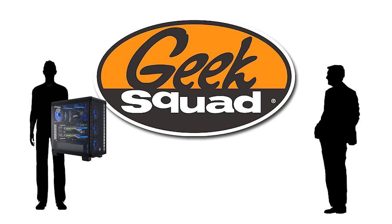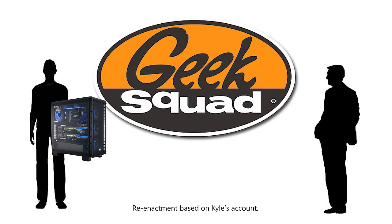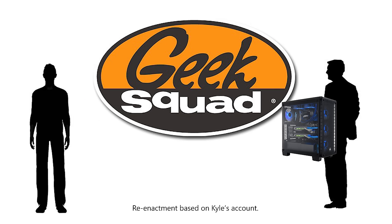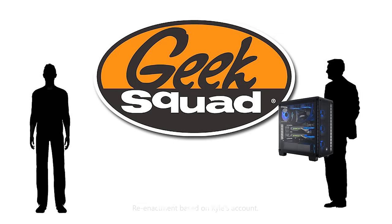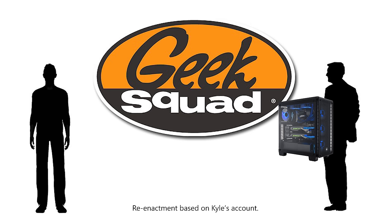So I just picked it up on Craigslist — I plugged it in, there's sound, the light comes on, but no picture. I don't know what's wrong. Did you plug your monitor into your card? Yeah, I even watched YouTube videos to make sure I was connecting everything correctly, but still no picture. Okay, let me take it in the back and see what I can find. [Later] I've got good news and bad news. Good news is the rest of your computer works fine. Bad news is it's a bad graphics card — I took out the graphics card and plugged it up with onboard and it's running just fine. So how much would it be to replace a graphics card? Do you know where you got it from? I reached out on Craigslist and of course he won't return my calls. That MSI card may still be under warranty — there's a serial number you can reference and they may replace it if it's relatively new, but this one isn't working anymore.